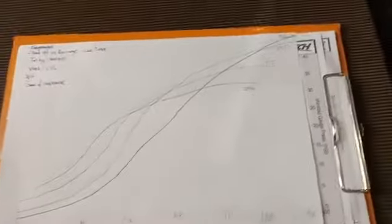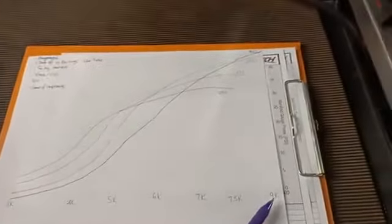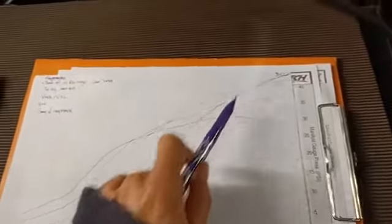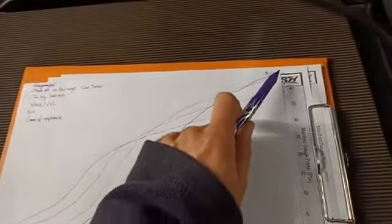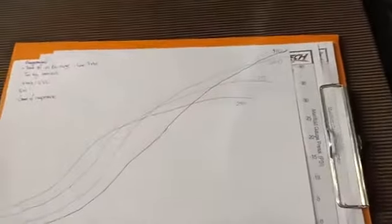So maybe that camshaft is going to be peaking somewhere around 10, 11, 12,000 RPM. Well, how far do you want to take your engine? Some of these drag engines do spin to 10, 11, 12, 13,000 RPM, and they've got fairly big camshafts to be able to do it. But you've got to look at the camshaft in the rev range that you're looking to use your engine. So in this case, if we were only going to rev to 9,000, because that's all our engine's built for, going to this big camshaft is going to make a slower engine, because although we end up with a higher peak power number, our overall power through the rev range is a lot weaker compared to the other engine.